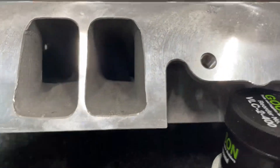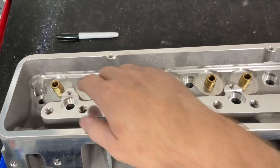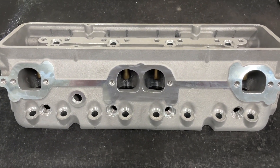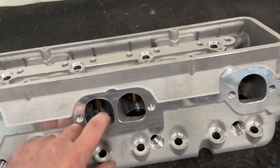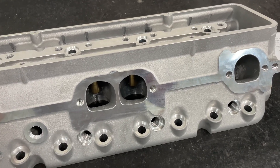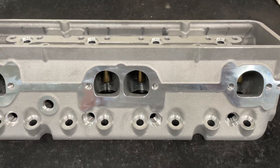That's how they fill in the port. Looking at the rest of the head itself, it's not much different from other Profiler heads for a small block Chevy. It's got the rail here for the old flow bar and it's machined right here for the rocker bar - it's nice, although I don't know that people buying this are going to run shaft rockers, but it's a pretty sturdy platform. Looking at the exhaust ports - they look the same as the 195 but they are not. Their shape is the same as the 195 and 210s but here's the difference: these are at stock exhaust height. The Profiler 195 and 210s are raised up about 0.200 inches. These are at stock height, so because of that it flows less, but it's supposed to work better with headers.